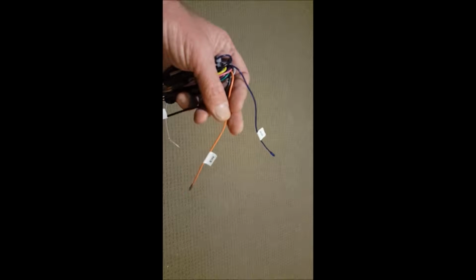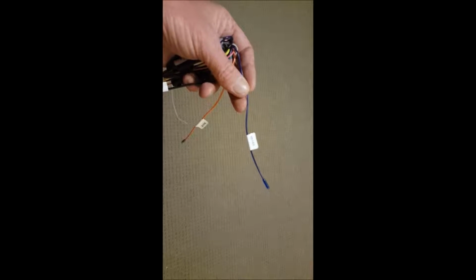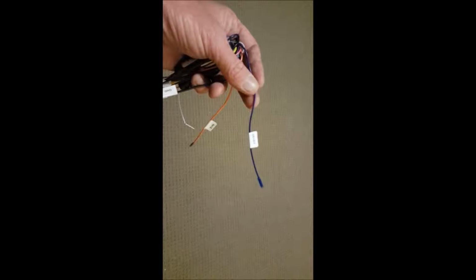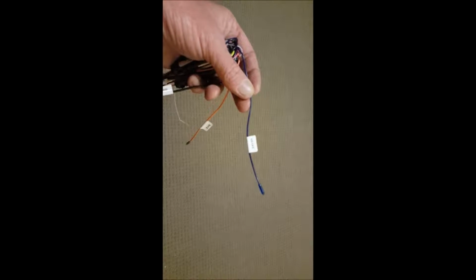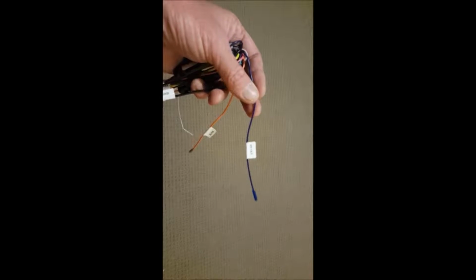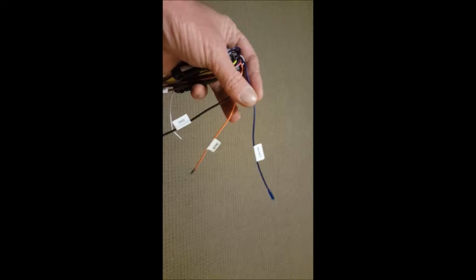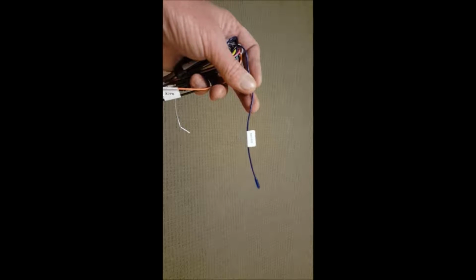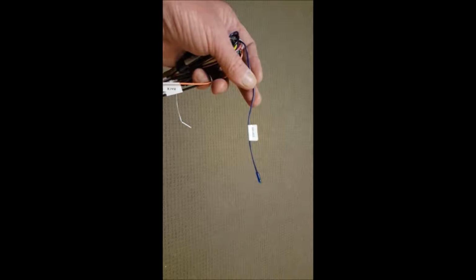If that doesn't work first go, have a look at connecting this to a positive wire. Try it with a positive. What that'll do is tell your Joying head unit that you've got your handbrake on, and it will allow that rear AV input on the back of the head unit to work. So if you have a bit of a think about it, when you haven't got your caravan on, use your normal reverse camera. When you have got your caravan on, switch the positive feed off going to this wire and switch a positive feed going to that wire, and that should switch on the rear camera on your caravan, so you can look at your head unit and see where your caravan's reversing into.